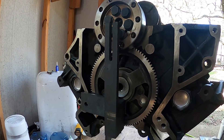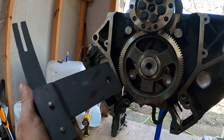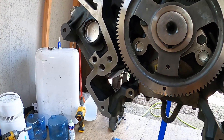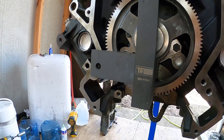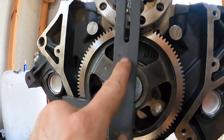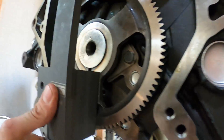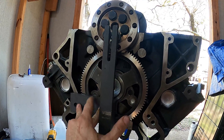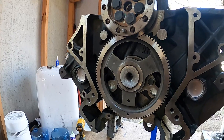If you're wanting to know how to use this timing tool — I didn't really see anybody explain it. The tool itself has these two notches right here on the bottom of it, and then the bolt hole that goes right there. I believe it's one of your transmission bolt sizes. You stick it in, put your bolt in — you probably just have to get a shorter one from the hardware store to make it nice and snug, or do it like I did where I just set it on there. The groove here has a pin right there on the end of the crankshaft, and it has to line up with both pins in the camshaft lined up with the hole lined up with the crank. Now the engine is timed and I can take the tool off. If anybody needs a 6.0 timing tool, let me know and I'll cut you a good deal, because I don't think I will ever be rebuilding another one of these.